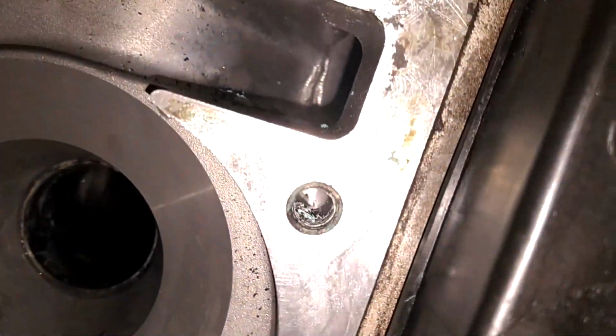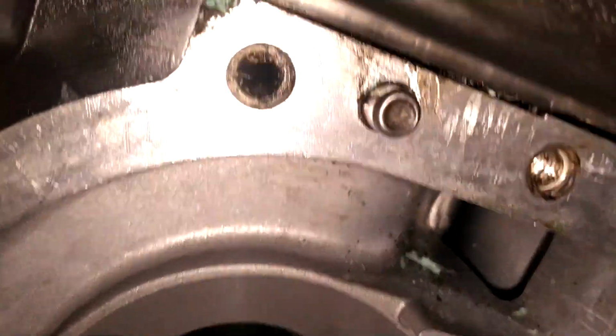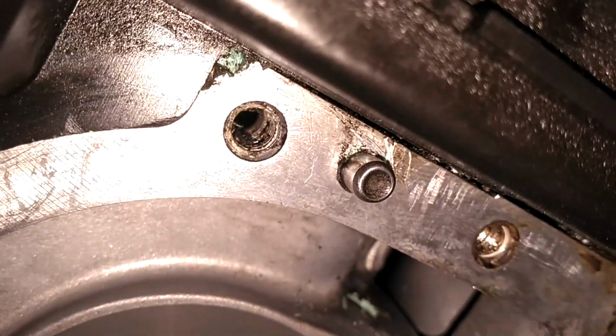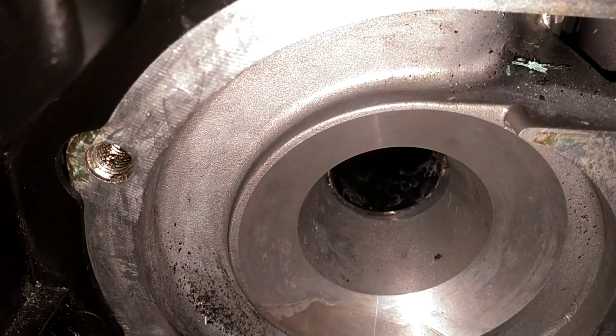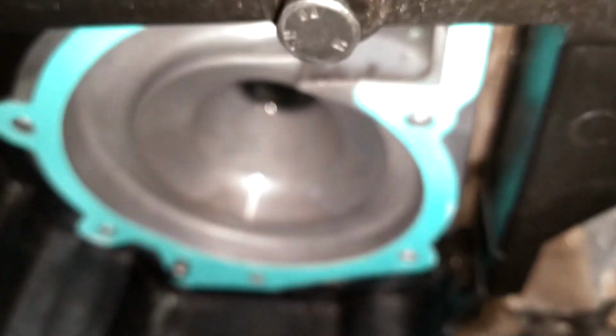Will you guys please quit putting gasket and sealant on these water pump gaskets? That is causing me and other people a lot of work trying to clean this off. There's no reason to put any kind of gasket maker or anything on these Volvo gaskets. They seal themselves. They swell up when they get wet with coolant, and they create a good seal. No reason to seal them. Lost an hour cleaning that gasket. The gasket holds in place real well by the 2 holding pins.